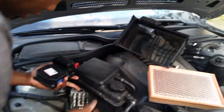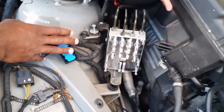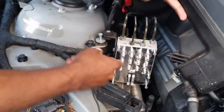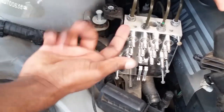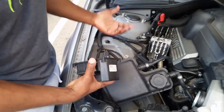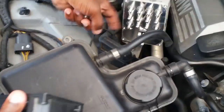I left the ABS unit module still connected — it does not need to be taken all the way apart. There's a bolt here that the ABS unit connects to to keep it from moving. Once you take this bolt out, you can move it up and get to that last bottom bolt. It has six bolts — five of the six are easy to get to, but you have to remove this bolt to move the unit upward to reach the last torx bolt, unless you have a swivel.